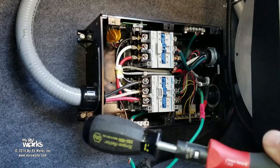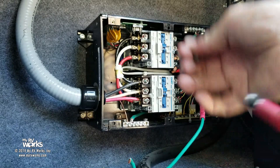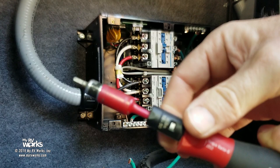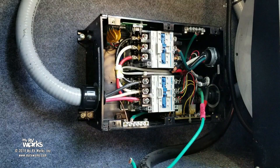So let me zoom you back out right there. Then this is another part, if you will. What it does is it gives me an open quarter inch end, and this goes in here like that. And then I've got a 4mm Allen. He snaps in. Make sense? So now we're set to 45 inch pounds. I've got an adapter that fits in there that allows me to put a quarter inch drive in it, or tool. And now I'm going to put my gloves back on.